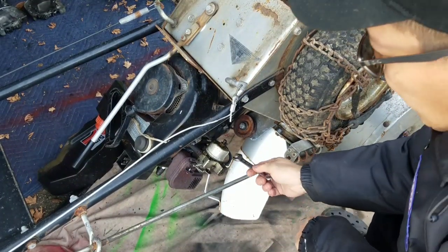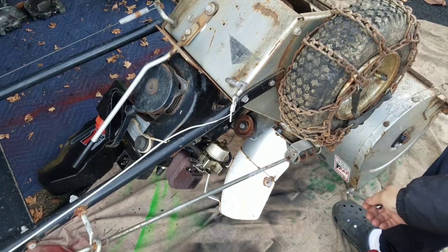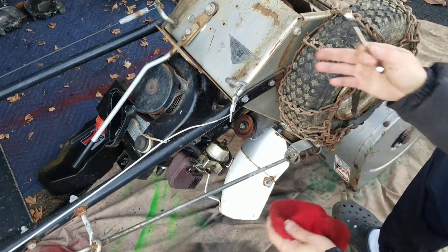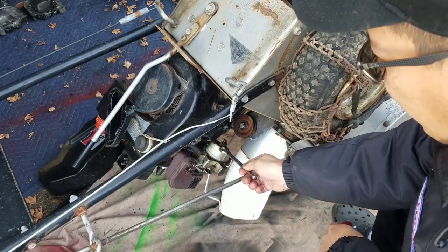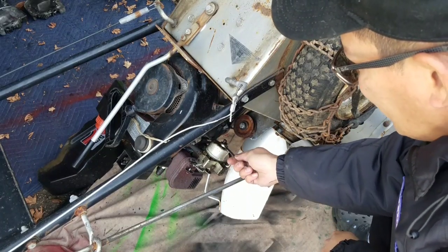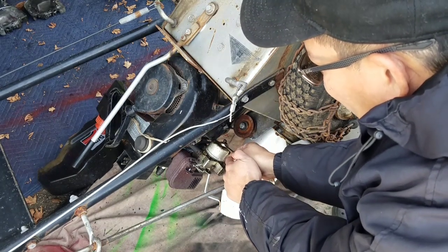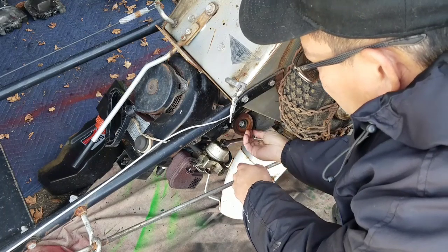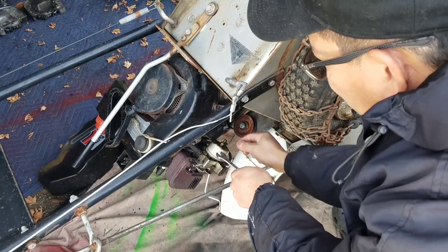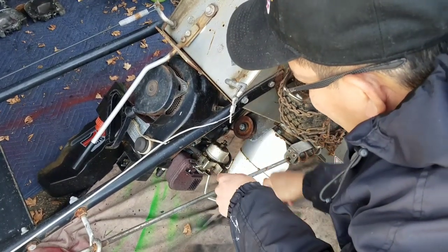So I hope you guys can see from this angle, because this is one of those older snow blowers, right? The auger is actually curved, so when you put it on its service position, it leans forward a little bit. But we have very good access to the carburetor right here, and since it does start and run on choke, we have a 7/16 bolt here, and this is actually the older kind where it's an adjustable jet nut. It's very greasy and oily here. Seems like somebody put two-stroke gas in here, you know?